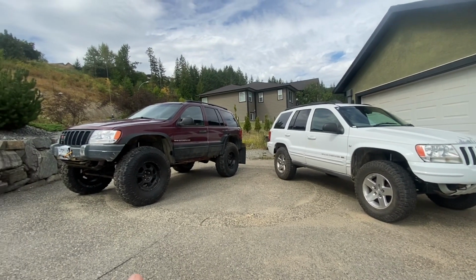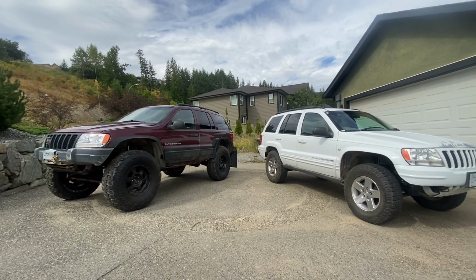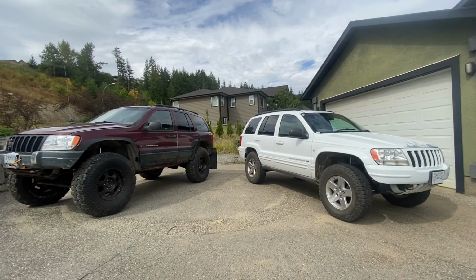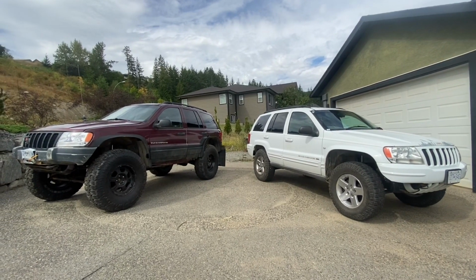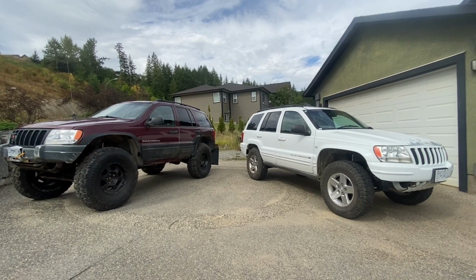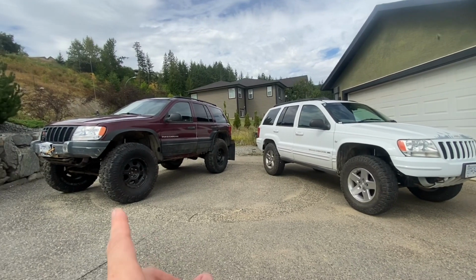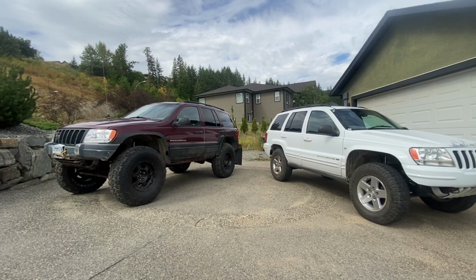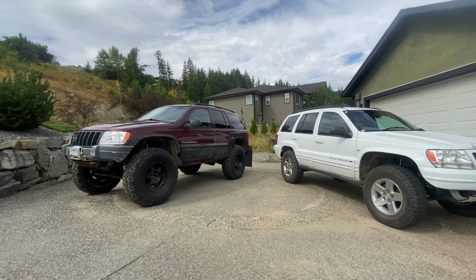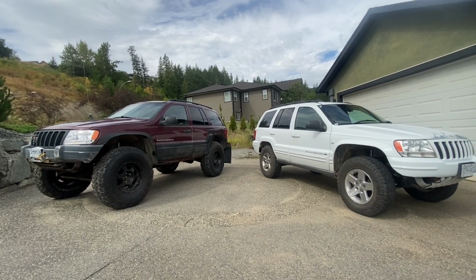Okay, first of all, the one over here has 4 inches of lift and 37s underneath it. This one over here has 2 inches of lift and 32s, a 255/70R17, basically a Rubicon sized wheel and tire. They're Rubicon wheels. This one's 37x12.5s on 17x8s with 4 1/4 inch back spacing, Pro Comp alloys, and Milestar Patagonia tires. I'm going to use these for some examples.